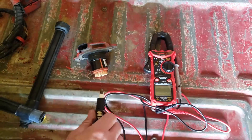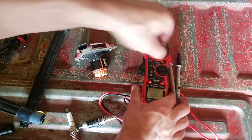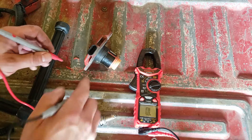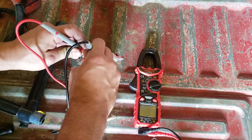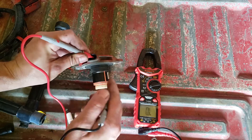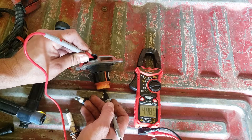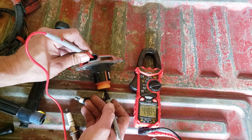So what you do is check with a multimeter — we're using this little Kaiweets clamp meter. Go to ohms and check your ignition coil pin A to pin B; you should have just less than a couple ohms — 0.8 ohms is perfectly normal. Then you check from pin C to the end. This is not a great coil so we will see — 4.48 ohms, see how it fluctuates. That is a sign of a bad coil; 4.5 or 4.48 means there's a dead spot somewhere in that coil.